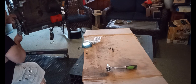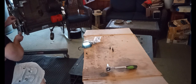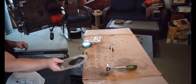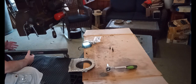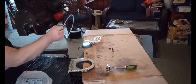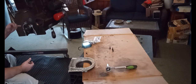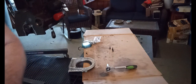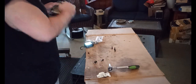Look what happened — I'm going to clean up everything and pop it back off. Something simple, look at that. This is what I'm glad I'm showing you, because this is what you don't want to have happen. Look how it popped down behind it. I'm going to clean all this back up, do it all over again, and I hate permatex. Look at that, what a mess. I don't want to get any permatex behind the cam. I'm going to clean all this up and do it again. I didn't want any permatex on that seal. I cleaned all the permatex out from behind there. Let's try this again.